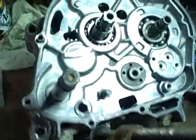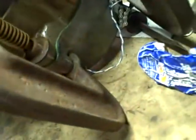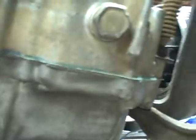I had a couple of gaps here and there. And in order to make sure that it's all pulled together, I'm installing some C-clamps temporarily. And I've only tightened those up just enough so I can squeeze a little bit out, so I can see that I don't have any gaps, and that's looking pretty good. Looks like on this side here I might still have a little bit of a gap, so let's see if I can get one more clamp and clamp this corner right here.